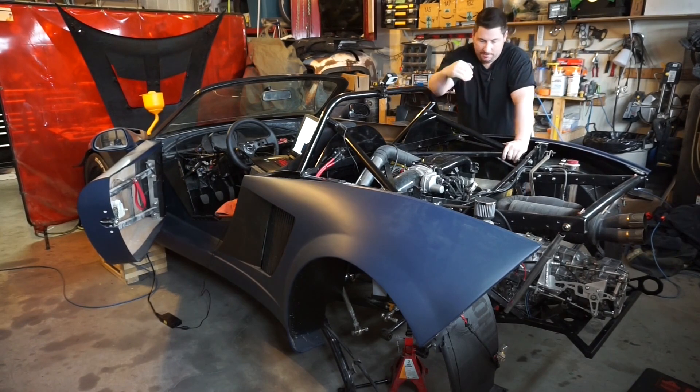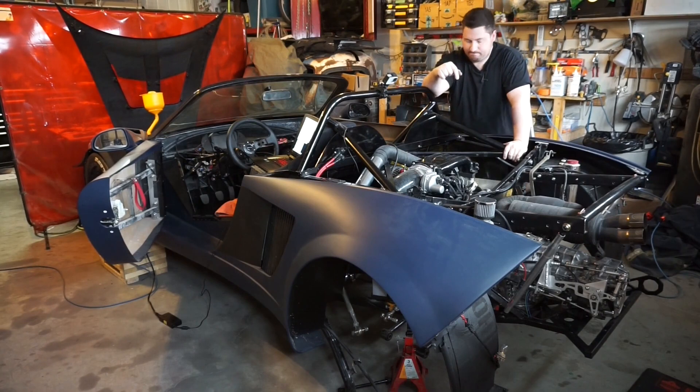What I've done up to this point: I have confirmed oil pressure. I can get oil pressure under cranking. If I continue cranking the starter for 10 seconds, I can get up to 50 psi of oil pressure. The oil is quite cold, but that's a really good sign.